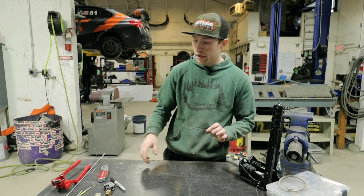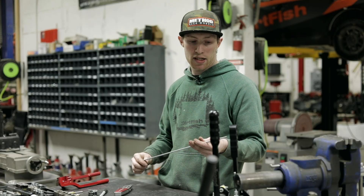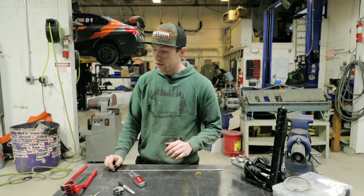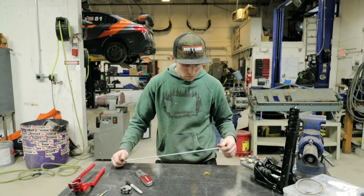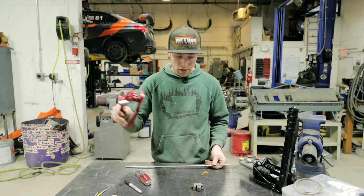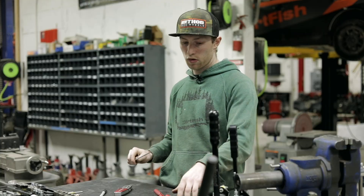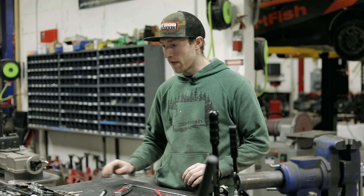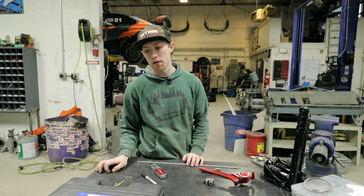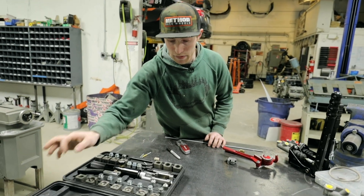Something that's not very common over here where we are, but maybe where there are salty roads and rusty cars, is bending and forming brake lines and then flaring the ends to fit. There are a couple of tools involved with making your own brake lines. This is just a tubing cutter that will help cut the line to length. A bender so we can shape our brake line — we don't want to bend it by hand because it'll kink, so we use this bender to give it a nice even radius. And then this is a flaring tool. This flaring tool is a more expensive model. There are some universal models at local parts stores that don't make a perfect flare, so we like to use a nice unit here that will give us a perfect flare.